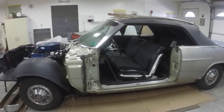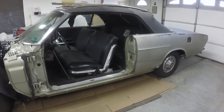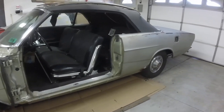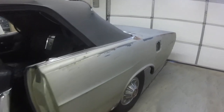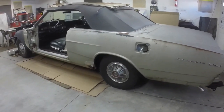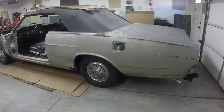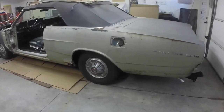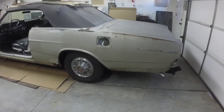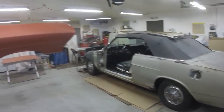And people, my dad even was like, well, aren't you worried about the paint not matching? And I said to my dad, well, do you ever remember me painting a whole car all at once? And he was like, no. And I says, do you ever remember paint not matching? He's like, no. And I said, well, it'll be fine. So I think that's kind of a myth. Certain paints, yeah, weather conditions, especially lacquers. Weather conditions affect hues of lacquers, but acrylic enamel, it's not fussy. As long as you mix the paint the same, it'll look fine.